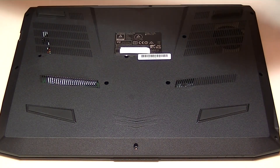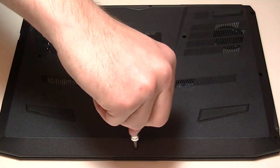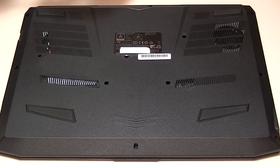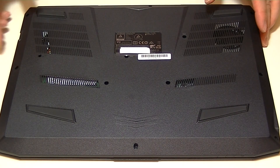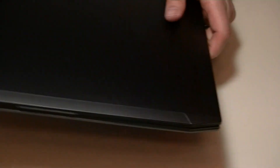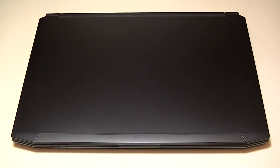At this point we're just going to put the bottom cover on and reinstall those 13 screws, and we should be good to go. Again, when you get this thing up and running, if you plan to do any heavy processing or long gaming sessions, you need to download the Intel XTU program to drop the CPU voltage by 150 millivolts to maintain healthy temperatures. Other than that, you've got your own custom home-built gaming or workstation laptop and saved yourself some money in the process. Thanks for watching and please subscribe!